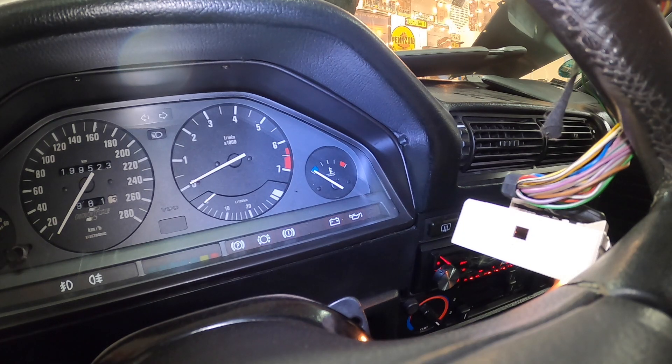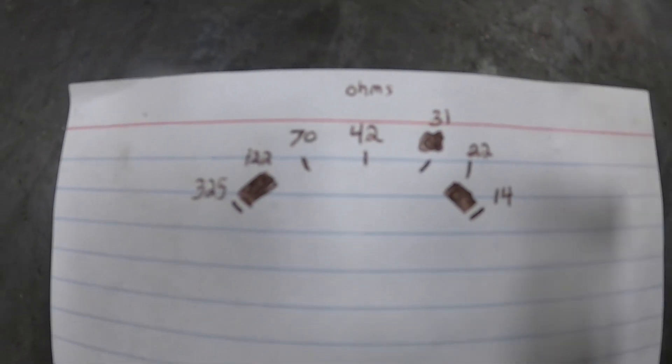As you decrease the resistance, the temperature goes up. I can really fine-tune this — I can get it right on that hash mark, stop there; right on the middle hash mark, stop there; right on that next hash mark. So I figured out exactly what hash mark I wanted to be on, figured out what the resistance is, then go back to the curve to find exactly what the temperature of the engine is at that time. You can basically reverse-engineer this, and I'll show you how to add resistance to the line if you're using an engine like the N54 that likes to run hotter, yet you don't want to see the temperature in the upper range the entire time.